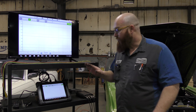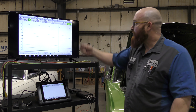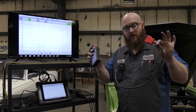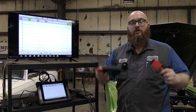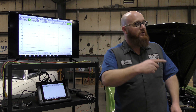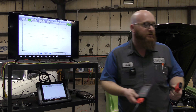The next thing we're going to show you is that when you're done oscilloscoping and want to check a different vehicle, you don't have to rip all this stuff apart. This is called the VCI — it's Bluetooth basically. You plug it into the diagnostic port and set this on the dash; there's no cables. You can walk away and it'll read everything wirelessly. So we've got Mrs. Wizard's Land Rover Discovery Sport — we're going to plug it in and show you guys this.